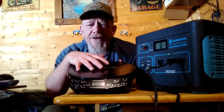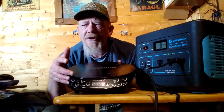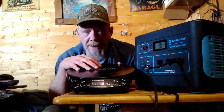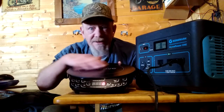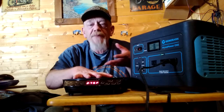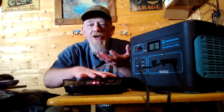Because it is cool to touch, it is safer for senior citizens who may be forgetful, and safer for everybody to avoid burning your house down. They say 143,000 homes burn down every year from cooking. There's a lot less chance of setting anything on fire with this because there is no fire, no flame, and the cooktop doesn't get hot at all. The pan can still be hot, but the cooktop doesn't. It can get warm after the pan sits on it, so you want to let it cool down. I can put my hand directly on it and there's no heat. It won't react because my hand isn't metallic or magnetic, so it doesn't sense any magnetic surface to transfer heat to and start the molecules moving.